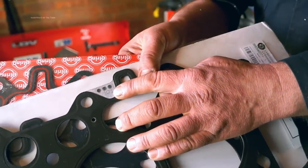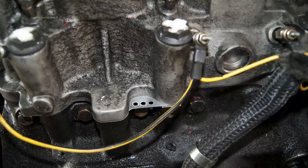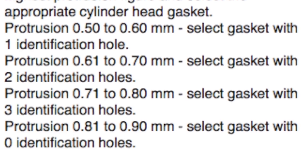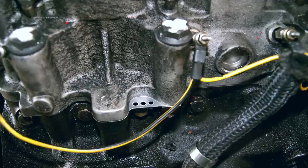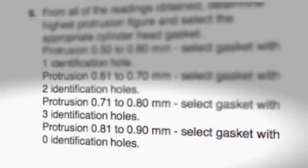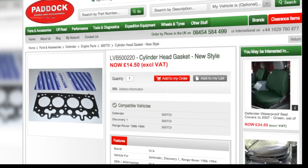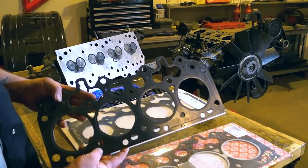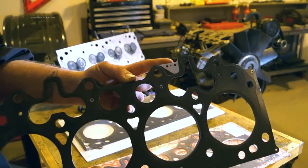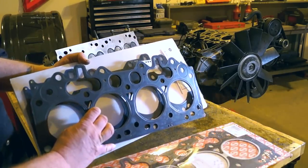The determining factor — or the thickness of the gasket — is shown by these three holes, and you should be able to see it before you remove the head. There is a range of gaskets ranging from zero hole to three hole, and it is vital that you know the difference and why they are different thicknesses. The three-hole thickness gasket seems to be the most common on these engines. Links for the head gasket part numbers are listed below. In my hand I have a genuine gasket from Land Rover, and here's the aftermarket one — there appears to be no significant difference in quality between the two.